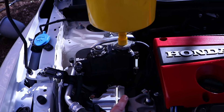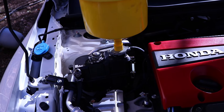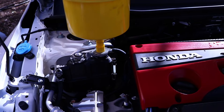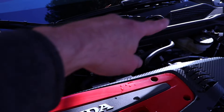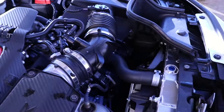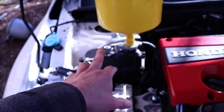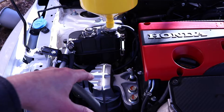An important thing to do before you go on the test drive — during the last two or three minutes — is to crank the heat on in the car. That way coolant has a chance to go through the heater hoses and the firewall and push out any bubbles that may be inside the heater core. Otherwise you'll run into random air pockets, and those will cause the radiator cap to open a little bit and release an air-coolant mixture out of the overflow tube.